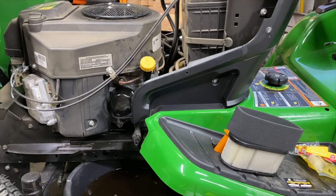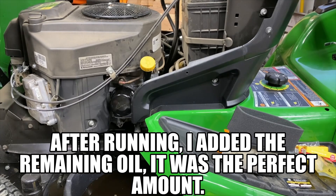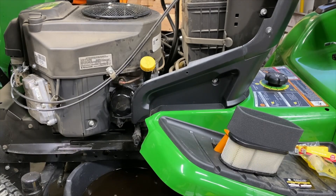That's pretty much it for oil changing. Of course, you'll want to start the engine up and run it a minute, then check again to make sure you don't need to add any oil. That is actually the next steps in the manual too: start and run engine at idle, check for leaks, fix any leaks, then check the oil level as necessary. And that is it for an oil change.